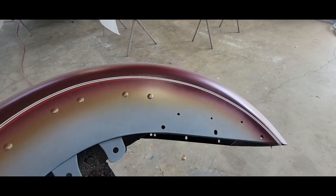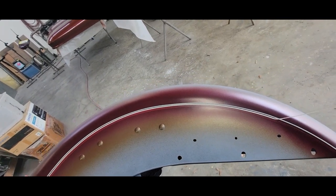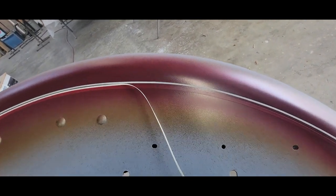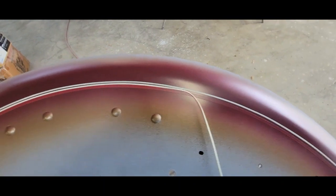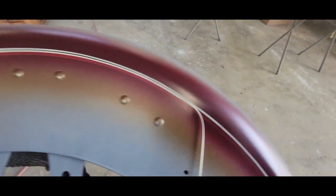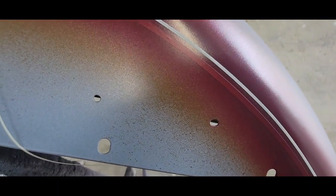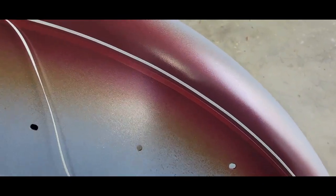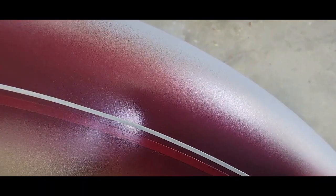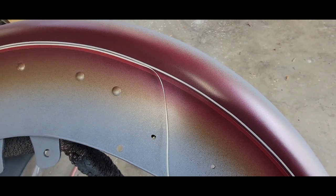So when I pull this off the center tape, you can see that that gap will be slightly larger than a 16th and it'll be smaller than an 1/8 inch. So that's how I do this. I'll spray the black first, which goes from the bronze stripe, which is this tape, down, and then in between the stripes is the purple, soon to be coated with the candy.